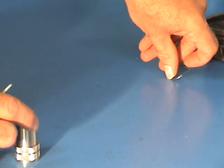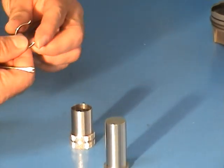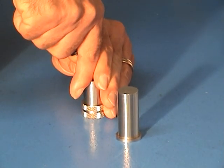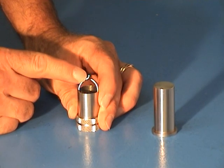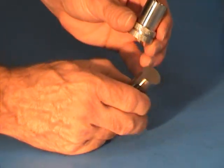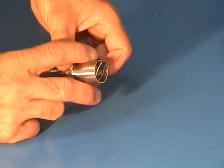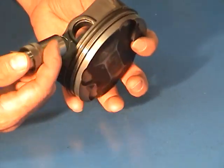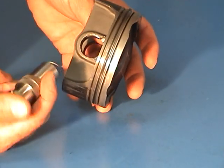In this case, the next one is going to be the dog leg — it's a similar process. Insert into the sleeve at the small diameter, just past the opening, leaving the dog leg and the open end of the circlip protruding, and tilt it at an angle. Insert the plunger from the other diameter until it contacts the base of the circlip. Now we insert the tool into its spot, making sure that the dog leg is indexed into its receptor on the piston.